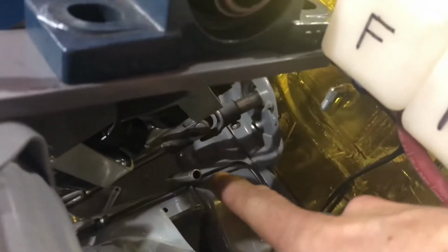I also started routing the fuel line. If we come under the car here, you can see I started routing the fuel line up here. I unfortunately ran out of the half-inch P-clamps to hold the line in place, so I had to call it early on that. I think that's something I'm going to try to get done next weekend though. Maybe I'll get the fuel rails and a regulator and all the fittings, the soft line and all that ordered up this week. That way I can actually get started on the fuel system and getting all the lines routed.